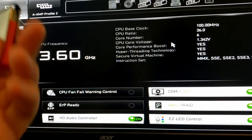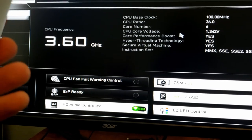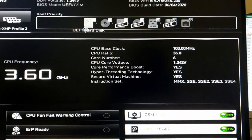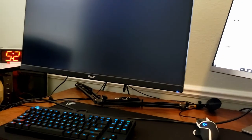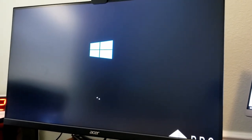I have a Windows installer — you can download it from the internet and put it on a USB drive. I'll power off, plug the USB in, and it should automatically boot from it. If not, you can adjust boot priority in the BIOS. The USB stick is in the front USB port. After escaping out, it's now thinking differently and we should see the Windows logo pop up.